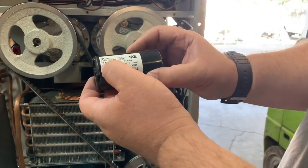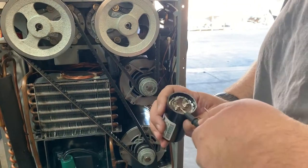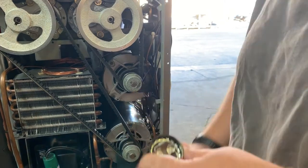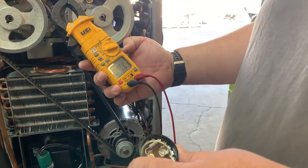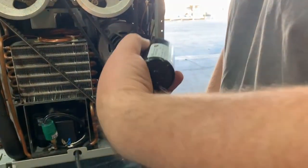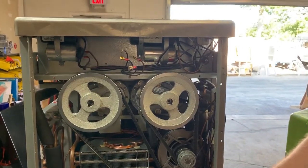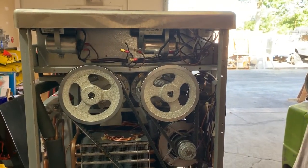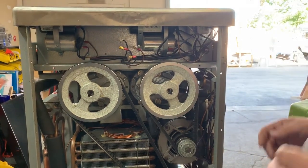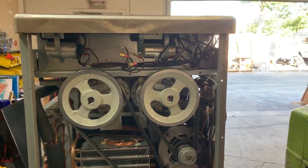On this one we're looking at 72 to 88 microfarads. We'll go ahead and put our leads on the terminals there, and we have 76.6 — so that is well within the range. And that's how you check capacitors. If it's out of range or way off of what the capacitor label says, then you probably need to replace that capacitor.